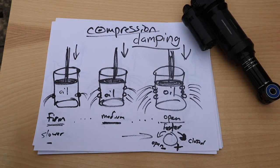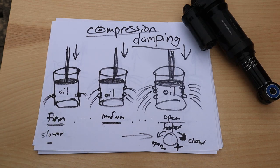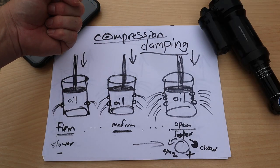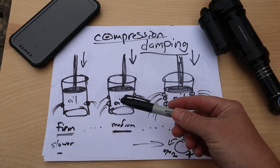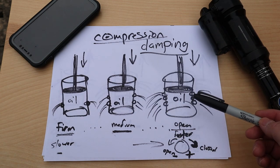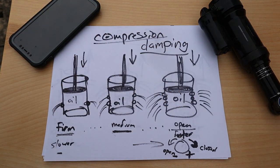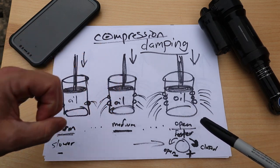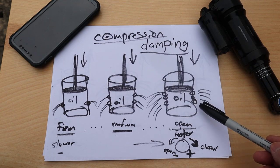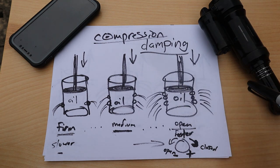The damper is the brains of the suspension system — it dissipates all the energy built up to restrict those oscillations. If I take my hand and try to push the plunger to evacuate oil out of the system through just one or two holes, it's a slow rate of compression. Now if we move to a canister with six holes and I grab the plunger, much easier — because six holes are evacuating the oil, that's a much faster rate or speed of compression. Think of open mode as all your holes being open: lots of area for oil to evacuate, faster compression speed, which feels like a softer mode.